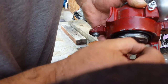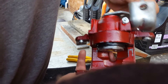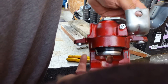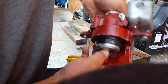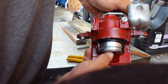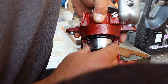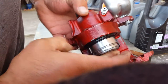Don't forget: take your clip and just keep ratcheting till that piston starts coming out. It'll get to a point — just look at your dust seal and help it spread back. It'll get to a point where the spring will end up pushing it out once it's past the seal, so just help that dust seal back again. Watch your fingers too because that spring's pretty strong. There we go — just slowly jiggle it out.